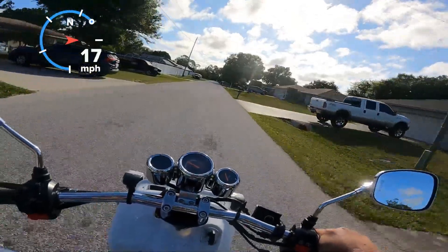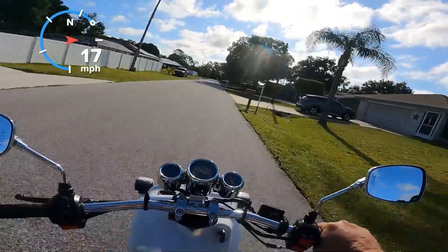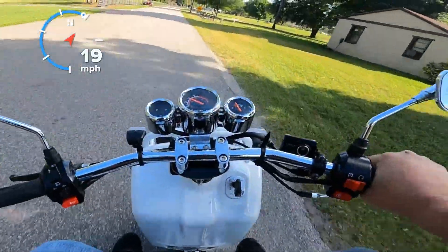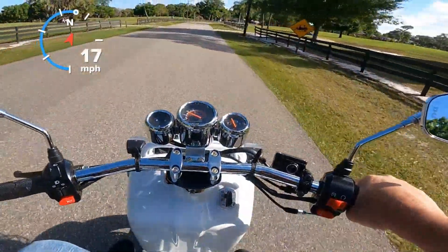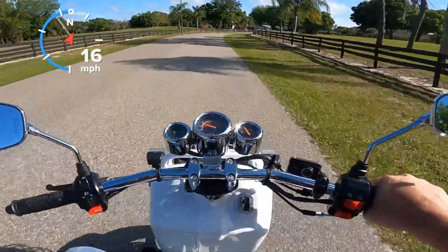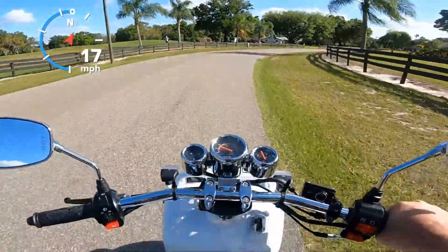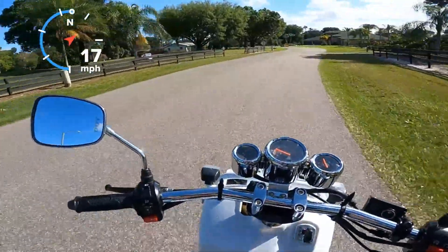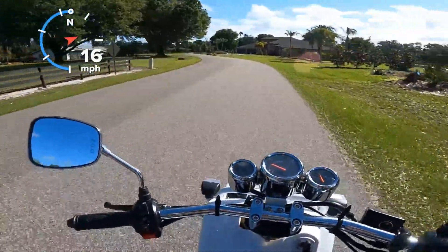If I lived in the mountains, I would probably use lighter rollers because it really has a lot of power down low — feels like I'd climb hills good. That was a good test of rollers. I'll be putting the stock 5-gram rollers back in — I like them the best. They're the quickest plus good top speed. I think I was doing about 39–40 mph with those.